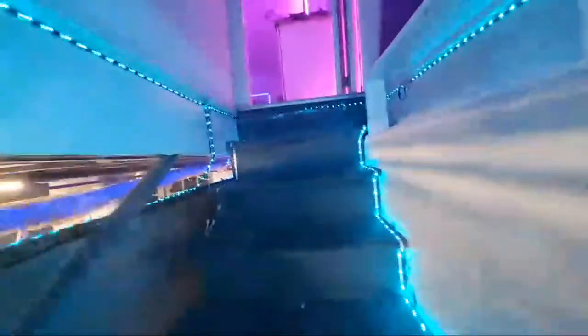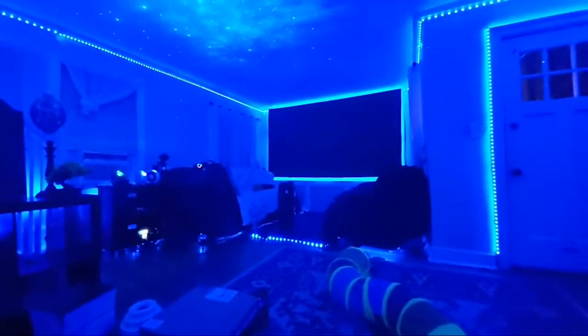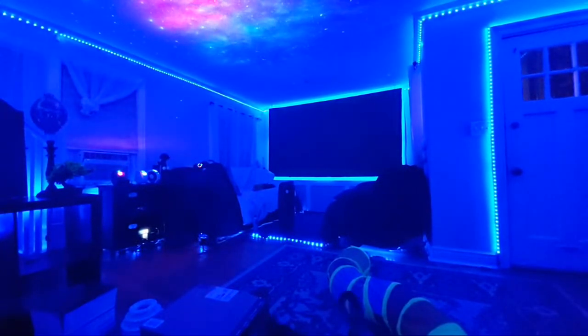I'm going to have my 6,500 lumen projector up and operational. I had no idea what was wrong with it — I was seeing this purple kind of display going across my screen, and I was thinking it can't be DLP. DLP projectors may have damaged mirrors, but there are no damaged mirrors in there. Since there's no damaged mirrors and it's an LCD projector, that means it definitely comes down to the lamp. Several people on forum sites confirmed it was the lamp having the issue.